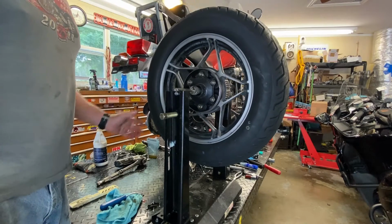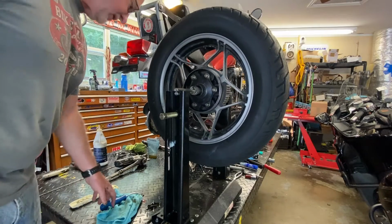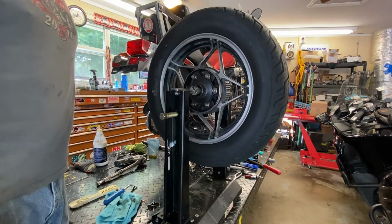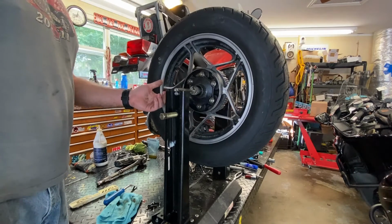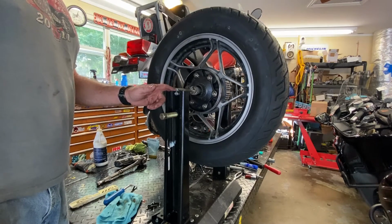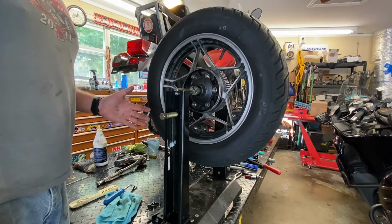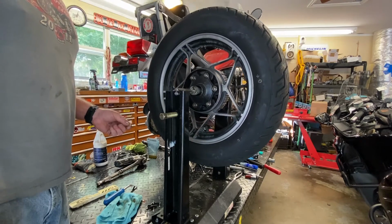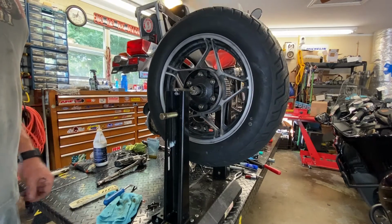So now she's ready to go. What I normally do is I give her a little spin, see where she sits. That weight is off. I did remove that weight. And then see where she wants to go. Sometimes it'll actually turn on the wheel bearings more than it will on these guys right here. It doesn't matter. You can get a feel for how this thing works by just using it enough times, and you get a pattern of how it typically responds to a wheel.